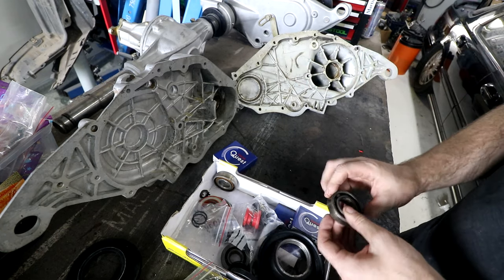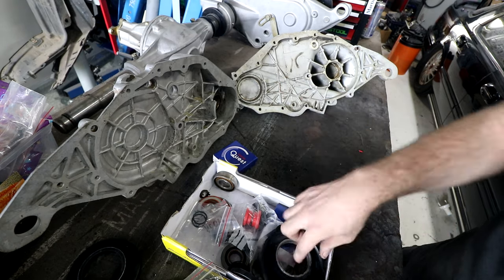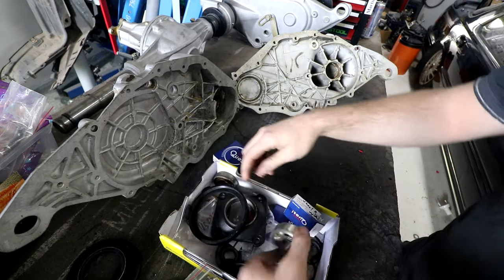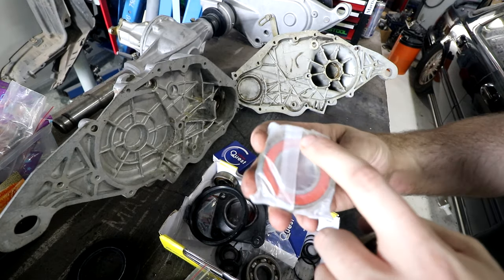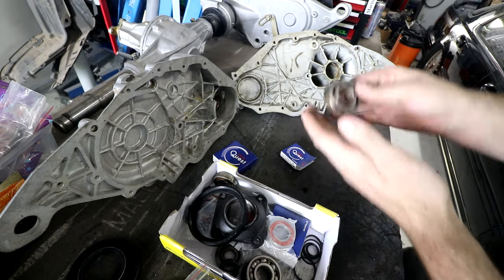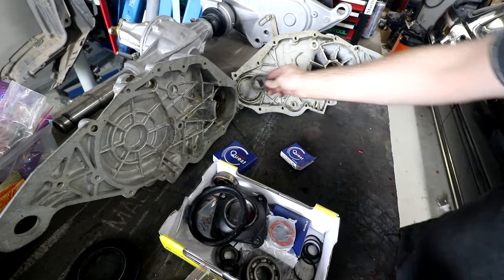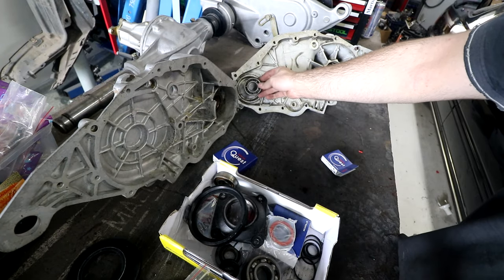What it seems like is supposed to happen is the bearings I took out of it, as you can see, they're unshielded. A modern bearing, well, not a modern bearing, but a shielded bearing, has got rubber on each side, and that's got grease packed inside it. All the bearings inside here don't have shields on them, because obviously this is full of oil, so you don't need their own grease in the bearings. The oil just goes in the bearing because it's in there.